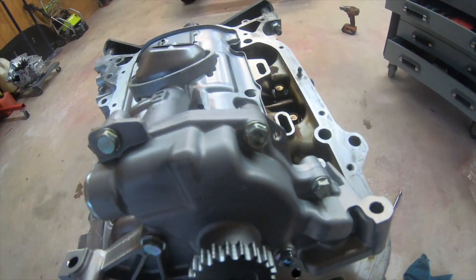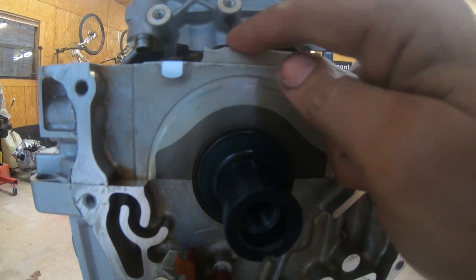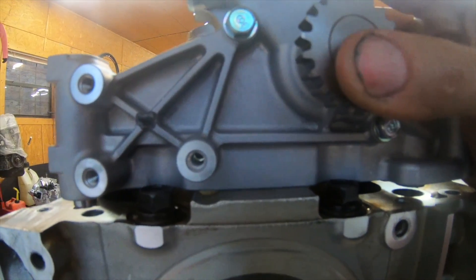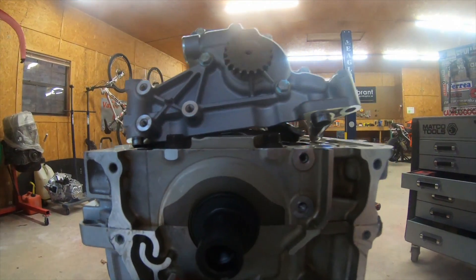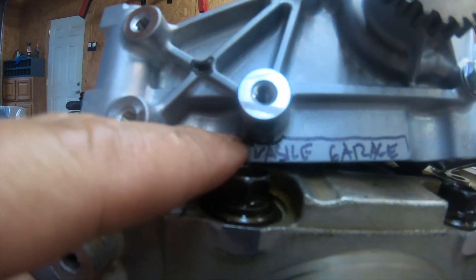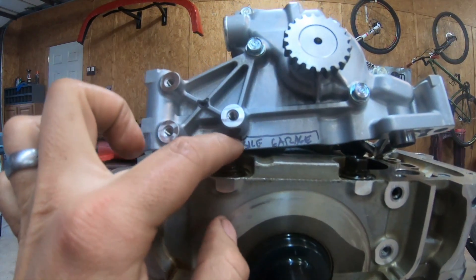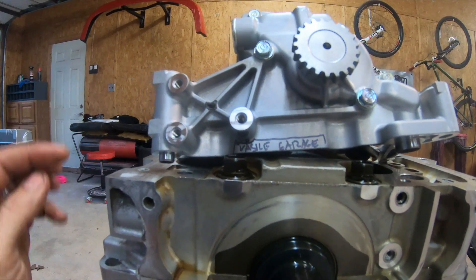This piece on the block is in the way. If you line the pump up right there, you can see exactly what it hits. So you have to cut right there. With better lighting you can see the obstacle — cut right there, but don't go too crazy because you need to bolt that tensioner for the chain that goes around the crank. Don't go too high. Go straight up and then right there — tape all the ports so you don't get any shavings inside.